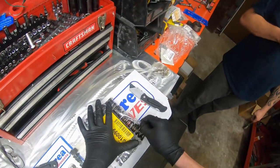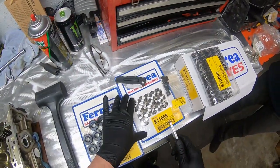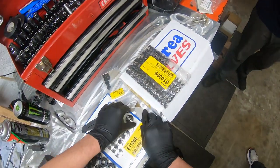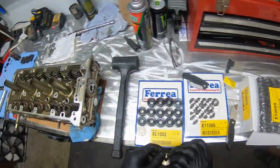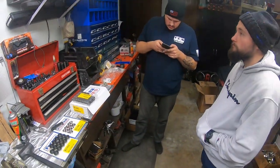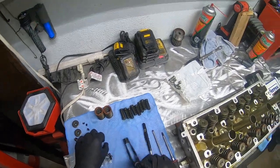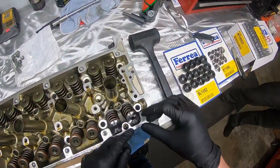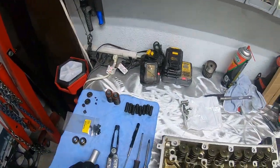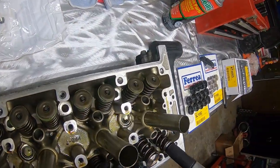So they won't work? This is D1745882. Well, it's got gears in it. It should have straight cuts in it. Helical's angle. Yeah, because the early ones, that comes up as a 6-volt oil pump gear. But it also comes up as an Evo 89, which is helical. So I don't think they make straight cuts anymore. Right. So I seem to remember something about them being revised. Straight cuts better now. Yeah, because it doesn't side load them as much. Either way, it either has straight cuts or it has these. There's no point in pulling it off with those in. I'm pretty sure I remember them being straight cuts though.